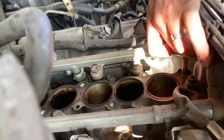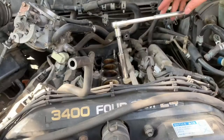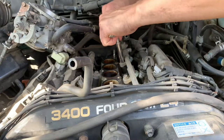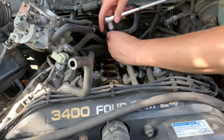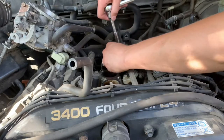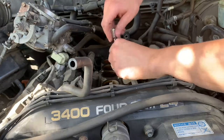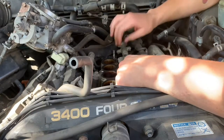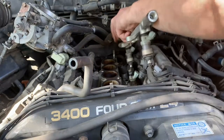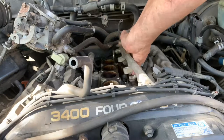This video was way longer - there were a lot of things that were just a pain to do and took a lot longer than it appears. With the miracles of movie magic I was able to edit that stuff out. There are two 12mm bolts to get that fuel rail off. Pull those bolts out. There's a vacuum line on the backside that I should have taken off, but I kind of just winged it and left it attached.